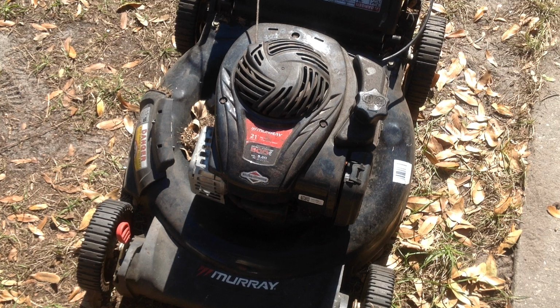This is the final video on this Murray 500E 21-inch cut. It's a 2017 model year. This one was a little bit of a stinker. I bought it with no compression. The push rod on the intake valve had fallen off, rectified that. Went through the carburetor twice. The third time I changed out the carburetor after noticing it had an aftermarket replacement carburetor. Somebody had put a new carb on it.